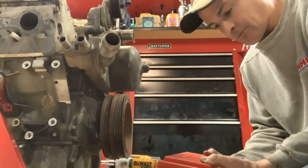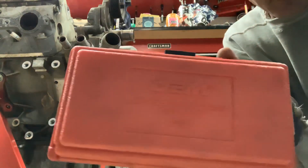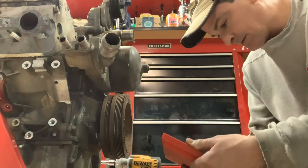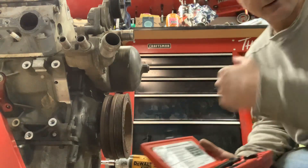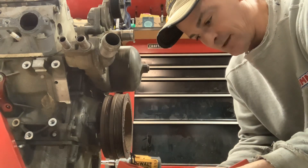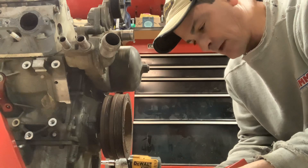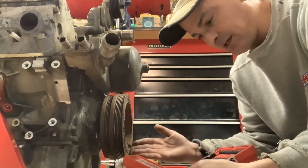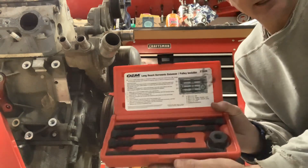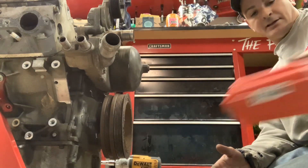The installer is going to be a long-reach installer, OEM part number 27306. It's actually going to cover Chrysler — that's what it's mainly made for and advertised for — and GM on the inside. They're going to have Chrysler, Jeep, Dodge, and Ford. Ford is metric 12 by 1.5, Dodge is 1.75, another Dodge is 14 by 1.5, and GM is going to be 16 millimeter by 2.0.